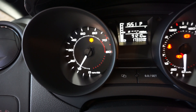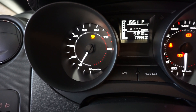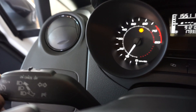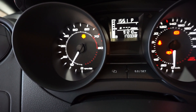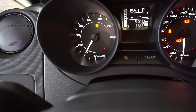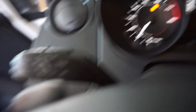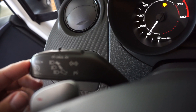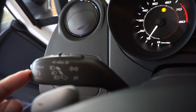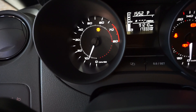We have four map versions here, the same as with our RS3 car. Now we selected MAP1. We always have to have the brake pressed while we are doing this, otherwise the Multimap will not accept our choice. To exit the Multimap mode, we press minus and now the car is back to the RPM.